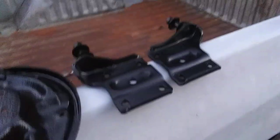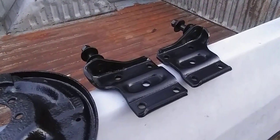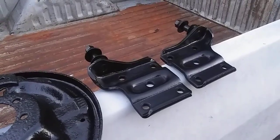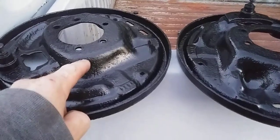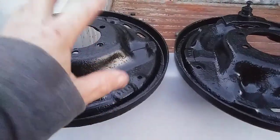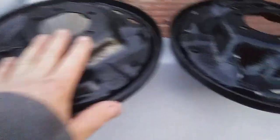Got the shock plates all done with several coats. They didn't even have to be sandblasted — I'd already done that and just put several coats on them. Last time I did this one, I didn't get enough paint on it, and when it dried the metal absorbed some of the paint and turned it almost dull. Now they're all high gloss.